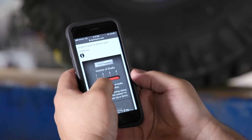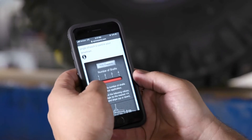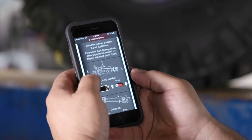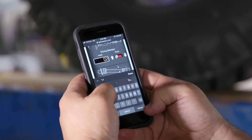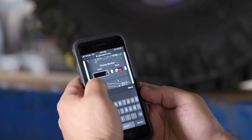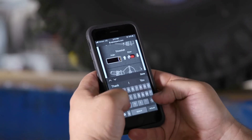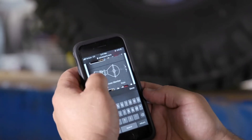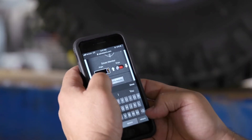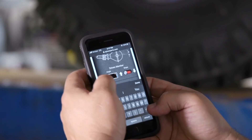We only have a single shaft — we don't have a center bearing or two center bearings that would make it have two or three shafts. Our driving member is our transfer case, so our operating angle at our transfer case is 2 degrees. Our drive shaft angle itself is 10.6 degrees, and then the driven member, which is the axle, that is 7 degrees.